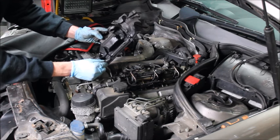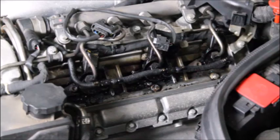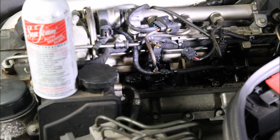Now you're ready to start inspecting. If you had leaking fuel injectors, you may see deposits on the cushioning foam you've just removed. You'll also see carbon deposits around the injectors if they've been leaking. Here's a close-up photo where you can clearly see carbon starting to build up from the leaking fuel injector — it's clear some work is required. The first thing I did is apply some degreaser solution that will start to break down this carbon, because a big part of the job is to clean up. My recommendation is to apply this and leave it overnight if you can.